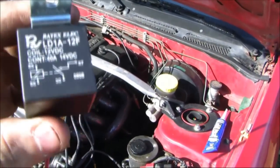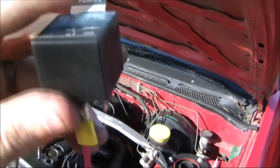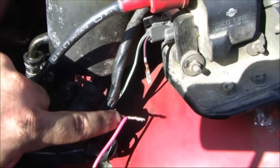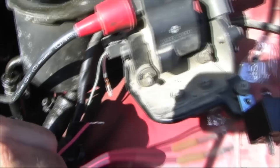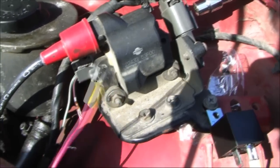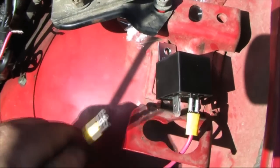From the battery or your reliable 12 volt power source, you're going to want to hook into pin 87. Next, you're going to want to take this wire here — the one that was giving power to the coil since it's not getting any power anymore — and attach a wire to it using one of these clips. This one is going to go to pin 85 on your relay.